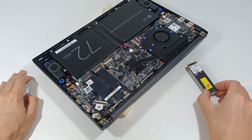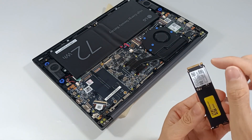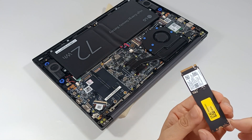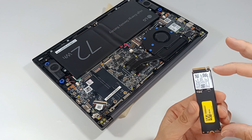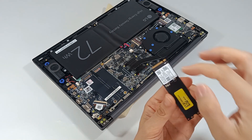How do you install an M.2 module on the computer? You have this M.2 module, which has this notch, which will fit the notch on the computer's M.2 slot. This is a 1TB module, 80mm long, and it has to fit in this position.